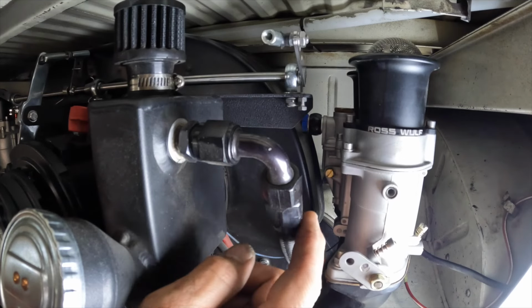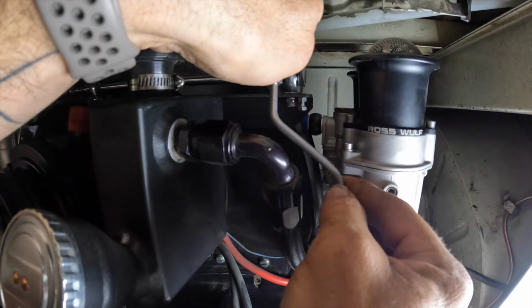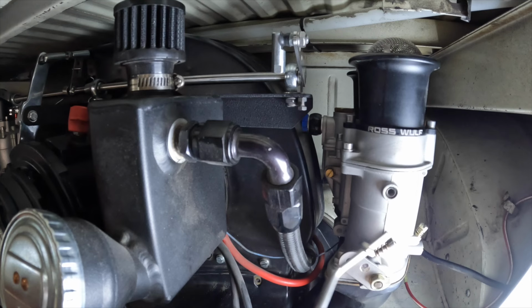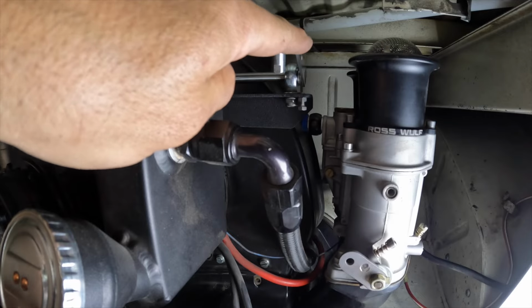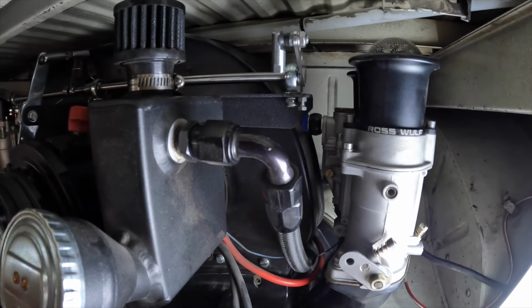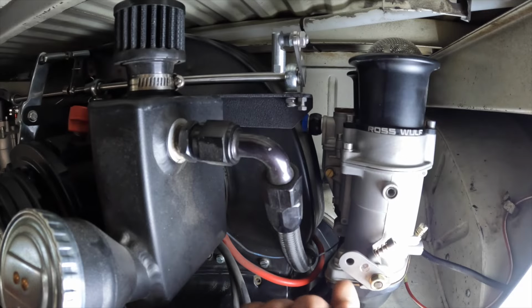So this one here, we got some obstacles in the way, and I'm not sure exactly how in the way that's gonna be. I think we're gonna end up clearing it in the long run, but be aware of your surroundings. That dude right there is an issue. We're gonna be proactive on this one, and obviously that's on the wrong side. We're gonna move that to the exterior of there, so this has a better angle coming down to that there. And we may have to do the same thing here, potentially put a couple of the washers on the exterior of this cam to keep that stem from hitting.